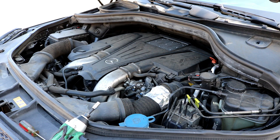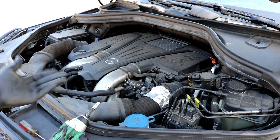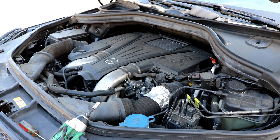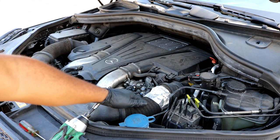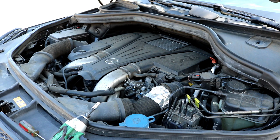As you can see, this has a damaged air intake inlet tube right here — they always break. I don't know why Mercedes keeps making these out of fabric. I know it's to keep the heat down, but they get heat soaked anyway. So if these happen to rip like this one already has — this customer brought it to me like this — it is what it is. You can go buy a new one or do your best to repair it.